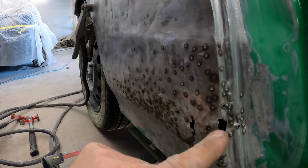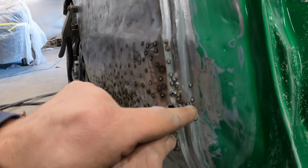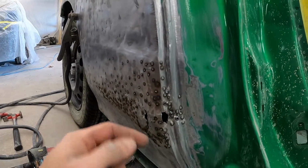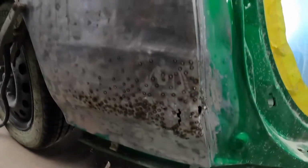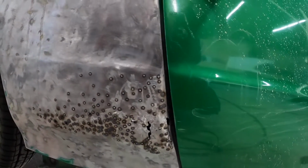I'm gonna have to do some building here and some work, and then I got to grind these back down so I can get right inside there, tack that, give it a couple little pulls. I might even try to get a pick in through here or through here, tap that. But I am getting pretty dang close to lining up with the door. It is still a bit off, but it's a bit closer than it was. So we are getting it.